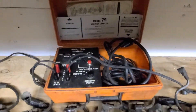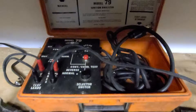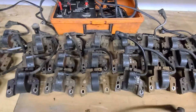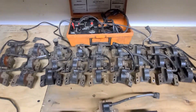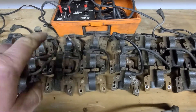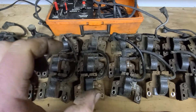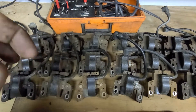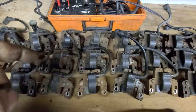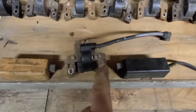I just wanted to show you how this works. You could pick one of these up at a yard sale or off eBay for cheap. If you have a bunch of coils to test, it's a nice way to do it. You can always test these just by putting them onto a lawnmower engine and spinning it — you'd have a spark plug grounded to the engine and spin it with an impact gun or a power drill. But this tool is actually designed specifically for testing coils.